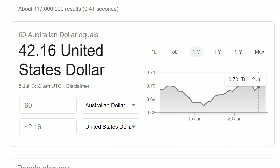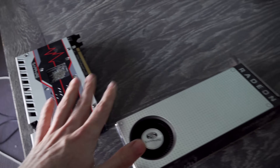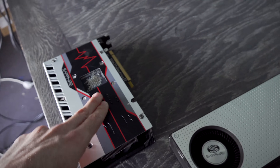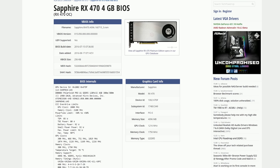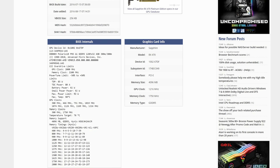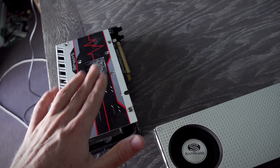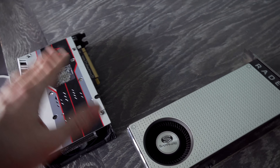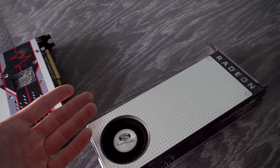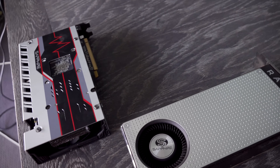It got me thinking with the RX 470 and RX 570 right together — what if you're into flipping gaming PCs, and also is it better for longevity purposes to load an RX 470 BIOS onto an RX 570? From the top of my memory, I believe these only lost about 10% performance compared to the RX 570s, but the RX 570s ended up using about 40% more power than the RX 470s. That power efficiency is way in favor of the RX 470s — less heat in the case, a more budget-oriented power supply, and fewer potential problems in the future.